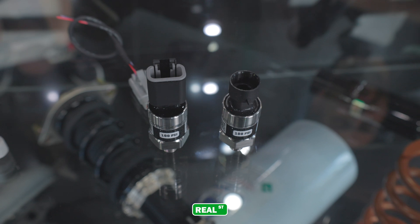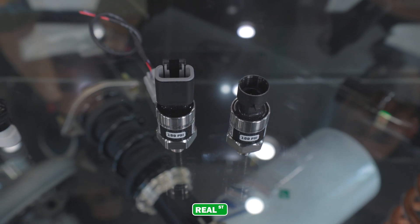The sensor element is encased in the body where, with a typical other brand, it may be firmly mounted. Our sensor is floating on an O-ring and then is epoxy-potted on top of that. So it has a level of vibration resistance built into the sensor for the lifespan of the sensor and for more accurate data, because when the sensor is vibrating the element may be moving, and you can probably see that in your trace depending on how closely you're looking at your tune-up.